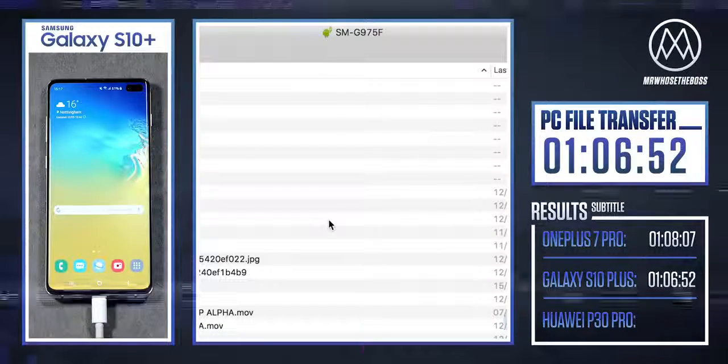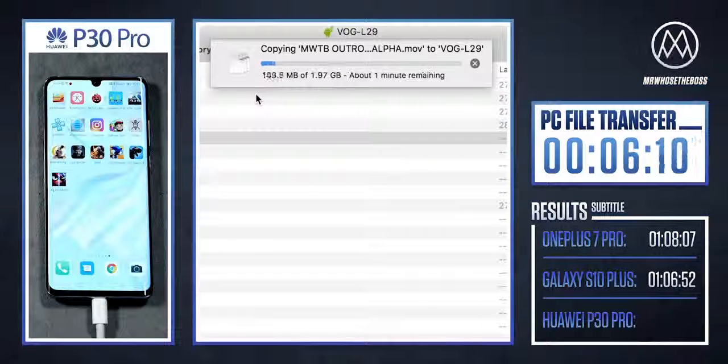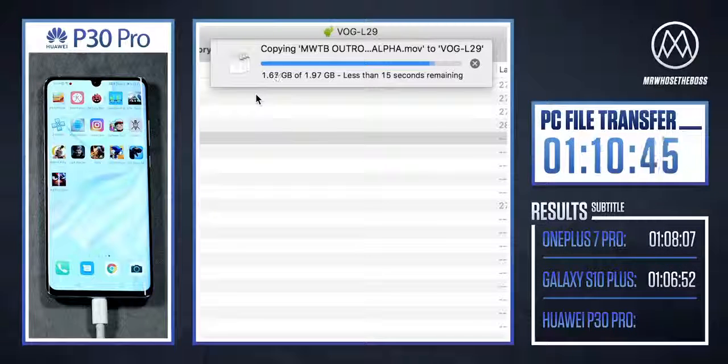And so, whilst this OnePlus 7 Pro does have fast UFS 3.0 storage, there are only specific usage cases where you'll actually feel it. A perfect example of this point is that the OnePlus 7 Pro has a USB 3.1 port, but the cable that comes with the phone is only USB 2.0 compatible.